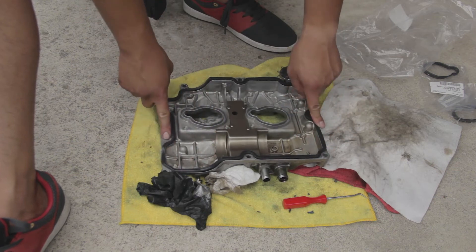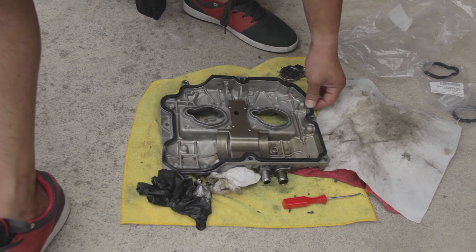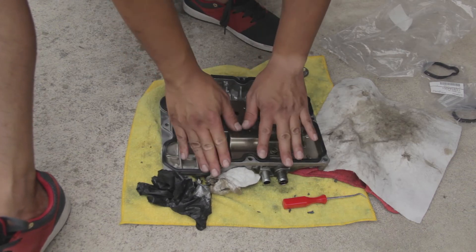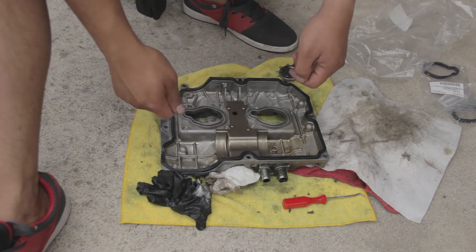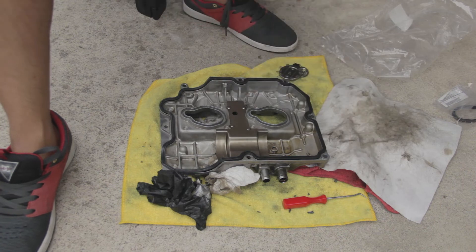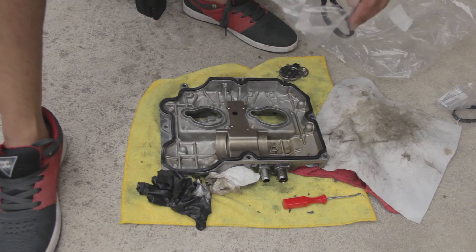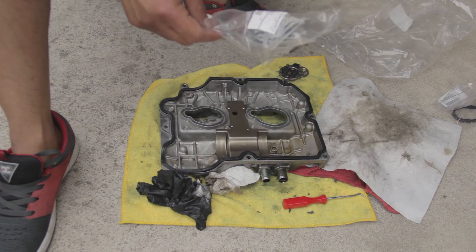Brake cleaner works really well for cleaning but we didn't have any. As you're peeling off the old gasketing, make sure none of it falls into the engine — if it does, get it out and clean out as much oil as possible. Just push the gasket in. It looks like I did a good job cleaning because it's not popping back out. If gaskets have been sitting in a box they'll take that shape and you'll have to fight them, but mine has been sitting flat for a while. In older Subarus there are rubber grommets for the valve cover screws; the dealership confirmed this vehicle does not need them.